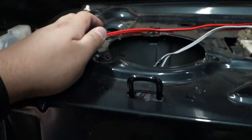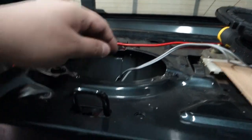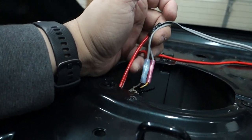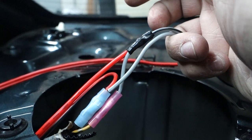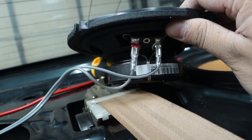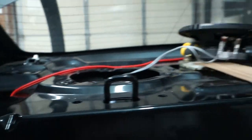You need a special bit to drill shallow enough to get in here. What they attempted to do was put a line-out converter here, but you don't need to cut these wires — there are adapters sold that can go there. Back here there's actually an adapter that they cut off and then attached these two wires to — unnecessary. You could have used those adapters to avoid cutting anything, since they didn't even solder in the end; they just attached them the same way the adapters would have.